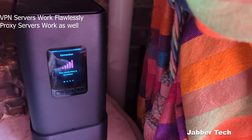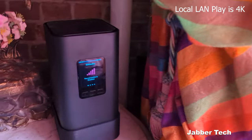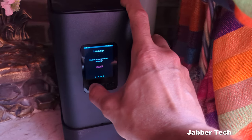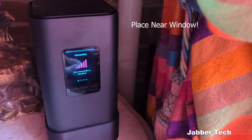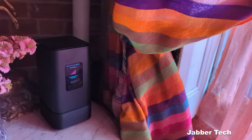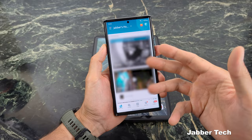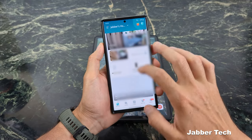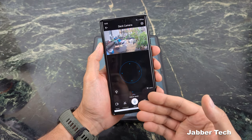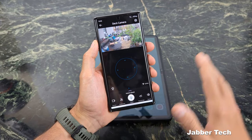Except when it comes to port forwarding — T-Mobile's service does not allow port forwarding. So if you have a Plex server, you're not going to be able to remotely stream without some finagling. It's going to use a proxy server and downgrade the quality just a little bit. And when it comes to cameras, if you don't have a system like Wyze, Blink, or Eufy cameras that use their own specific app, they're not going to work. But if your camera system has its own app that uses their servers to relay images to you, there are no problems.